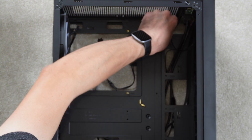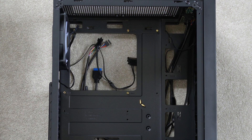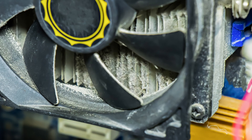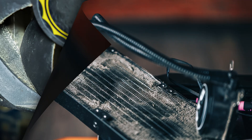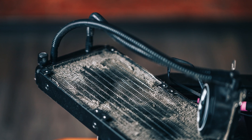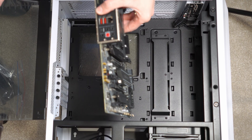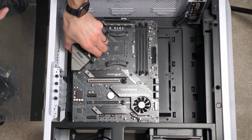The reason some people say it's important: firstly, the IO shield can in some cases help ground your motherboard to the case. The standoffs help with grounding too, but having your motherboard properly connected via both the standoffs and the IO shield can help with certain electrical issues. Secondly, it prevents dust getting into the system. And thirdly, depending on where you live, bugs could potentially get inside your computer — those are the main arguments in favour of taking your computer apart to get the IO shield back.